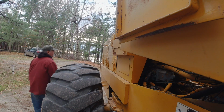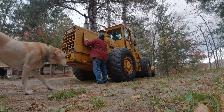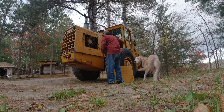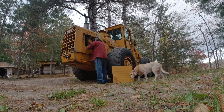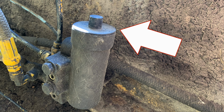Annoying. Anyway, what we're going to do here is adjust the governor pressure, so I go ahead and take off the side panel here. I get the side panel off, and I want to put the camera aimed at the governor. I'll stick in an old picture of the governor before I cleaned it up. That's what the governor looks like. And the actual twiddly bit's underneath this rubber cap, and it's just a set screw with a lock nut.